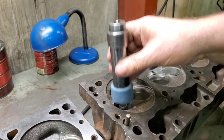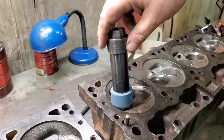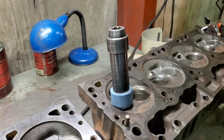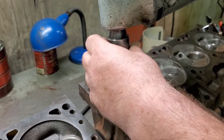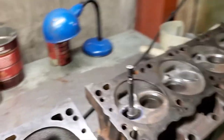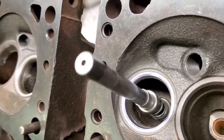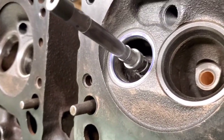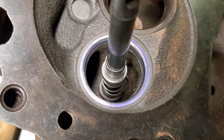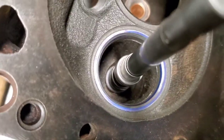Let's touch this — let's see what kind of contact area we have. I have a bounce spring in there and a bushing, so as you can see that holds me up off the seat. We've got a ball-bearing stone holder — it's not worn out like the old bushing styles. As you can see here, no camera trickery — we've got a seat. You can see where we didn't grind; we've got a top cut and a bottom cut.